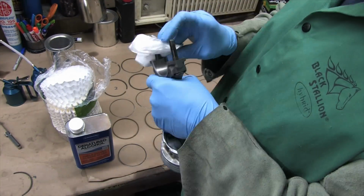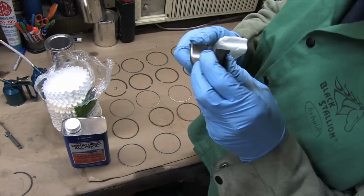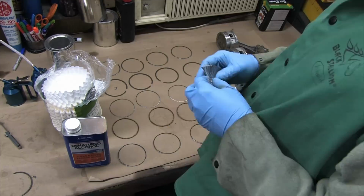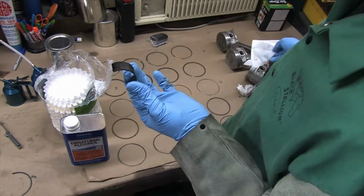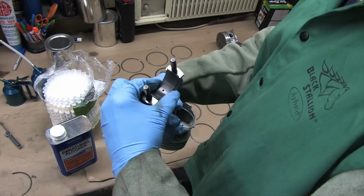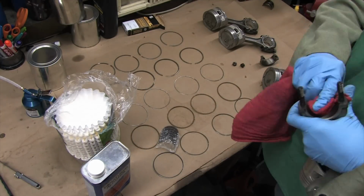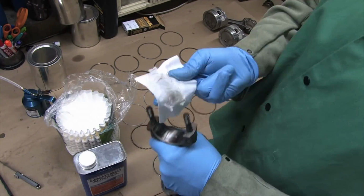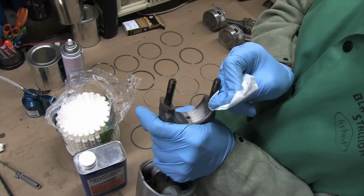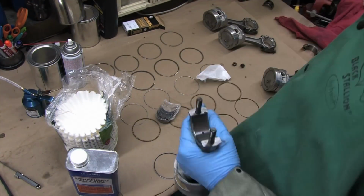When you're doing a dry assembly and your pistons are already assembled, it's best to get your rod bearing and oil clearances straight prior to installing the rings. In order to take those measurements, once again, everything has to be spotlessly clean. My process on all bearing surfaces is to clean it with denatured alcohol and compressed air. Just like with the mains, you need to clean the oil off the new rod bearings using the exact same process. This helps ensure that no foreign material becomes lodged between the bearing and the part. Since these parts are oil free, I'm putting a drop of oil on each rod bolt to soak in. Clean up the nuts for the rod bolts and lay them out in order.